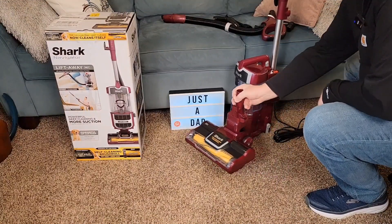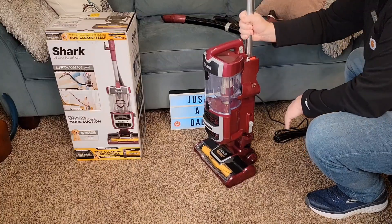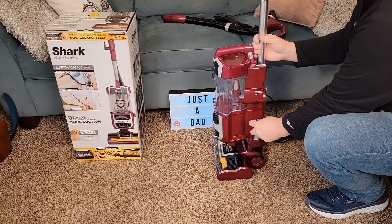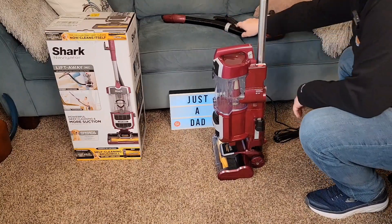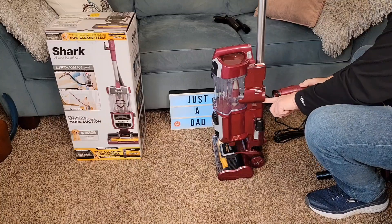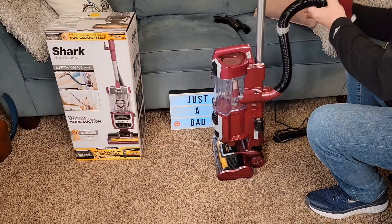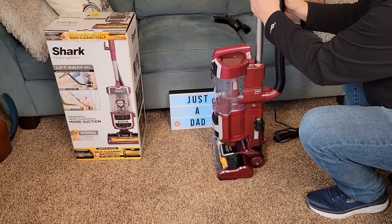I've got everything out of the box — I'm going to show you how to put it together. You've got this powered unit, you're going to snap it on here. Push it on — you want to hear that click so that when you lift up it doesn't lift up. We've got this attachment tool here, that goes right there. When you want to take the power lift-away, just press that button, and again put it on until it clicks. Here we've got the hose — there's a V, so you want the V to go in that bottom spot. Push this on until you hear it click, then this snaps on right here. Put your hose on first, then snap that on.